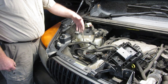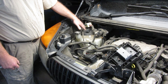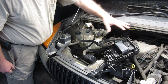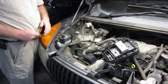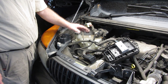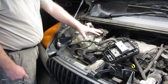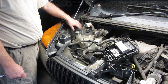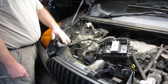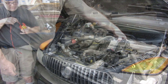The first thing you do before you can even take this battery out is remove the crossbar that goes across up underneath here. My son took that out at another time when we were messing with the battery. There are a couple of 10 millimeters here and I can't remember if it's a 13 or 15 millimeter up here that pops it off. Regardless, that has to come out before you can do anything else.